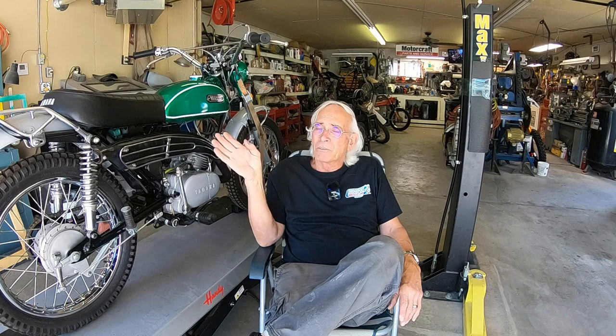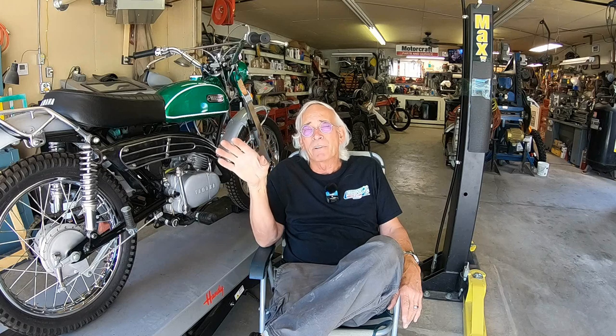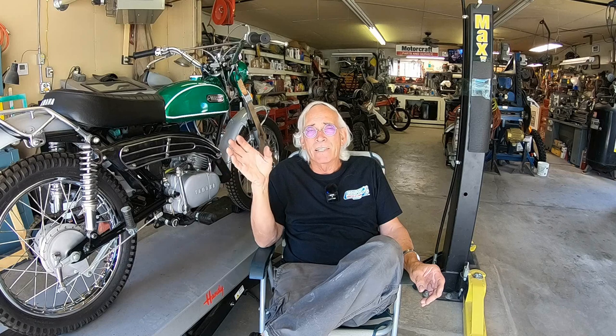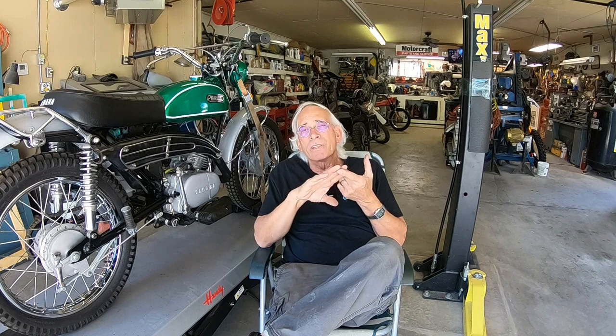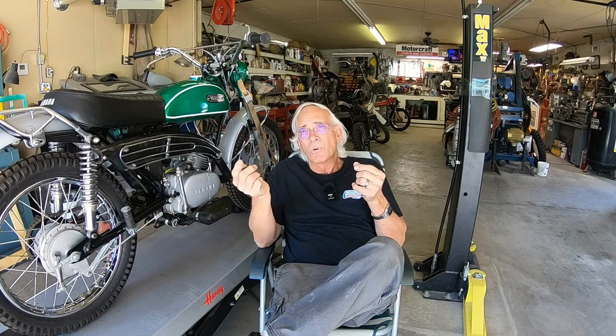But anyhow, when I started doing the painting on this, I'd just come down with salmonella poisoning, and I was just having a heck of a time just trying to stay on my feet, let alone paint. But I had already set up everything, I'd mixed things, and it just hit me. And I knew I had to get through it, because for each coat, you've got an hour time before you have to recoat. So once I put on the primer sealer, then I've got 1 hour at the maximum before I start recoating.